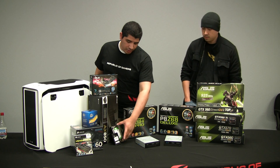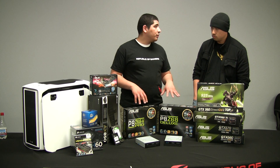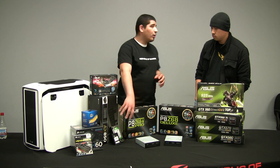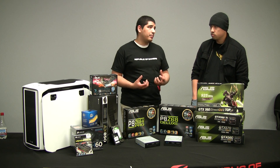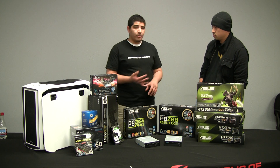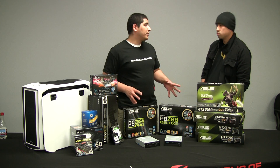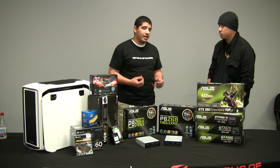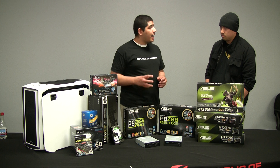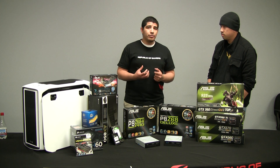We've got an awesome Western Digital three terabyte hard drive. This is a perfect drive to go with our UEFI BIOS which allows more than 2.2 terabyte support. But if we use this as a boot volume, while it's got really big storage capacity and solid performance, it's a little lower in spindle speed — it's not a 7200 RPM drive, so not as snappy as we'd want. We've also got a Sandforce II class 40GB SSD — super fast performance, high read and write, really low access times. It's great, but it's only 40 gigabytes. Not everyone can afford a 256GB SSD. So with Smart Response Technology, we can merge the two — dedicate the SSD as a cache for the operating system, and it will monitor application usage patterns and cache those functions.